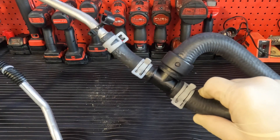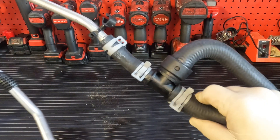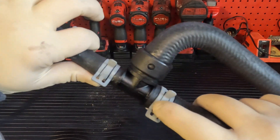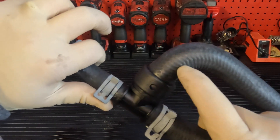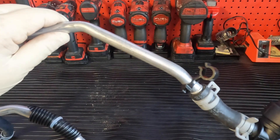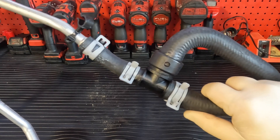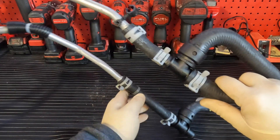This is a really bad design — not just in the sense that it's made out of plastic, but secondly they make you buy this whole piece, which is just a waste of money. And thirdly, this top heater hose that goes to the heater core — they didn't put a clamp on it; they put these little plastic connectors. If it doesn't break at one of these fittings, it will start leaking eventually and the seal just goes away. I wish they had made this serviceable. They could have made this piece out of metal aluminum like the rest of the line, with clamps, and you could have serviced just the T-fitting for probably five or ten dollars from Chrysler. But no — they do this idiotic way of having this thing connected. It's just a really bad engineering flop and a fail in my book.